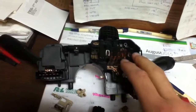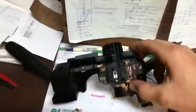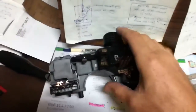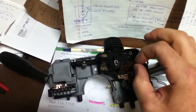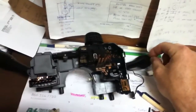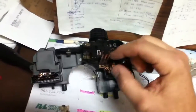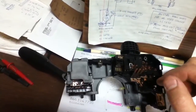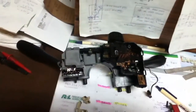This one had two Torx screws on top holding it in place. With just two screws, the whole unit pops right out — you unplug two wires and it's a real simple swap. But if you pull one from the junkyard, make sure you ring out pins 13 and 14 with the switch pulled out to make sure the circuit isn't overheated and melted. Simple fix you can do yourself — good luck.